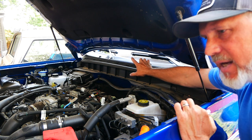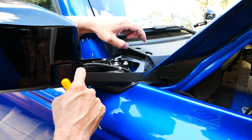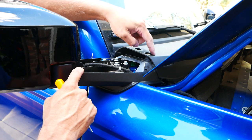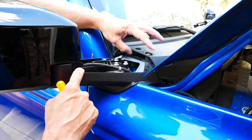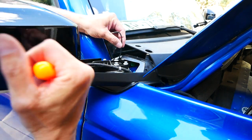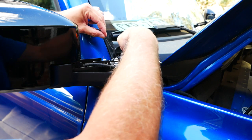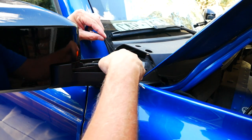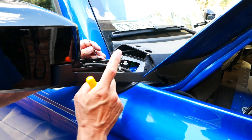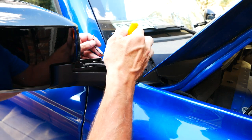On the other side, I pulled the cap off that goes to the mirror and also pulled out the accessory screw. You can literally just unscrew the AM/FM antenna right here, which pulls it up just a little bit. Then I took the power wire I had run underneath from the other side and tucked it underneath the mirror housing so it comes up here — that'll be plenty of room to connect to the pigtail that comes on the light.